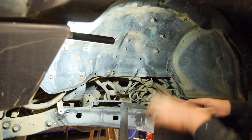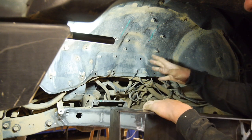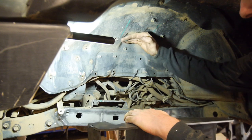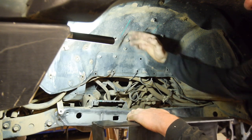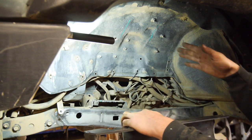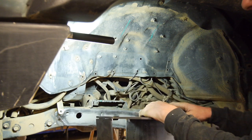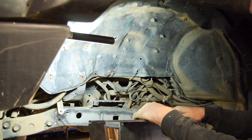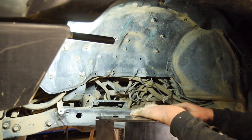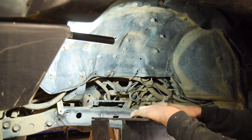We've just got to start with what we know — we need coilover towers, and these ones are made for the kit. I was thinking about potentially using Matt's ones because I think they just fit without having to cut the arch. But I also think I'm going to have to raise the mounts up on top of the diff to get over the radius arm. The extra height of Troy's brackets is useful, and obviously they're made for the fish plates as well. It's just going to be a matter of putting in what I know and mixing and matching what I can, because it's an unconventional setup — which is what I seem to like doing.